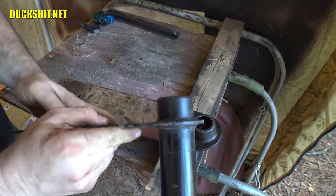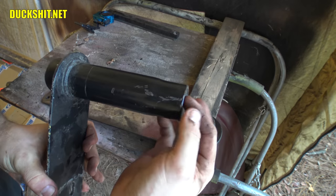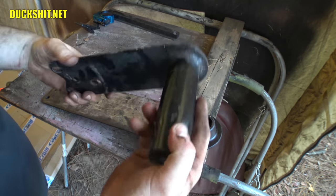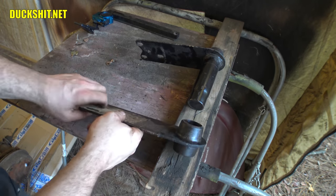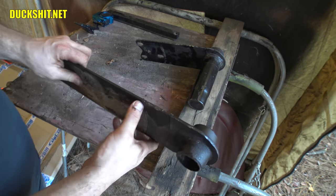Here are our spring plates. This is from a late model beetle - this is that tube I was mentioning. The long torsion bar goes all the way into the end here where it engages into the splines, and the longer torsion bar was to give you a better ride. But on the earlier Volkswagens they used a shorter torsion bar, which is the reason why this is so short now. You can see it's a little bent from me tweaking it trying to get the thing removed, but I think I can fix that.